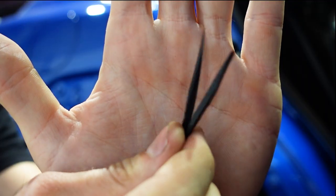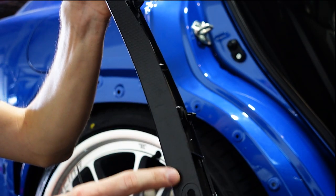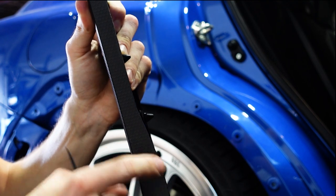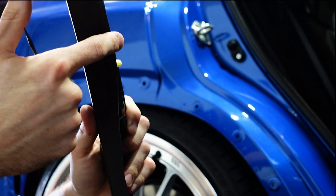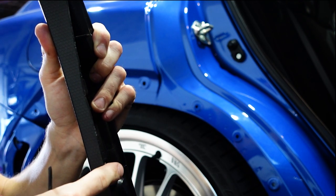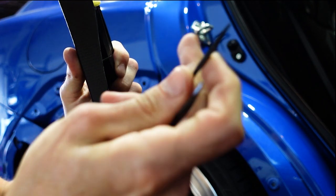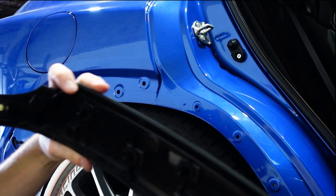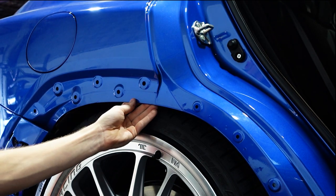It's really not a lot at all. This is the back section — where the pop clips go in and as it trails up towards the center of the tire, it actually from the factory curves in a little bit. We didn't have an issue back here, it was a little bit closer to the front. Right here where it starts to curve back out, we basically took a razor blade and skinned it coming from about the center up and then back. We did about three passes, took off maybe half an inch total of plastic material. Really simple, and we have a ton left to go. You could really trim this out if you wanted to, but eventually you're going to be at metal anyway, so there's only so far you can go.